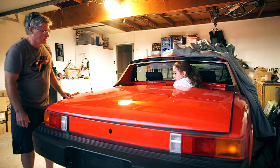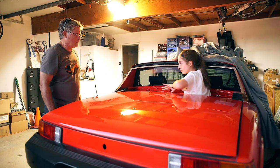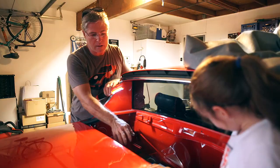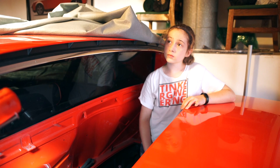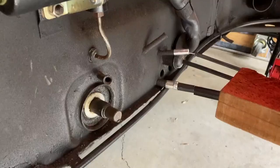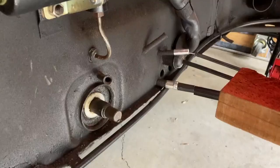Very roomy! I didn't realize there was room for another human being in there. Maybe you could put a car seat in here. I was thinking of like a deck for a golf bag or something. Maybe a wet bar. This is the Hyper 9 high voltage motor. You're going to have your three-phase cabling right here, and you're going to have the controller up here on this side. Most of the high voltage cabling — you have to connect the boxes together — it's going to go through the tunnel, all the way to the front of the car and connect to the front box.